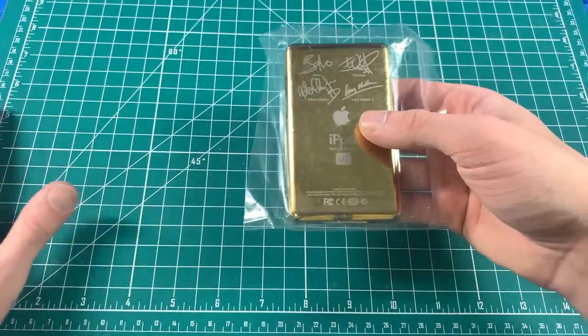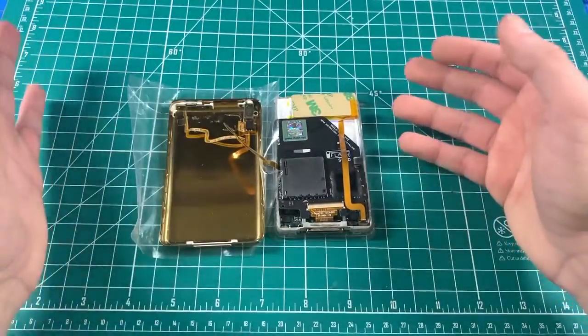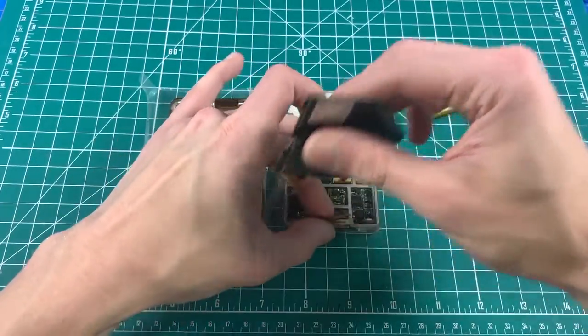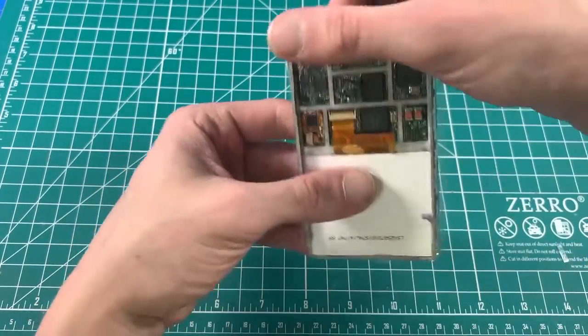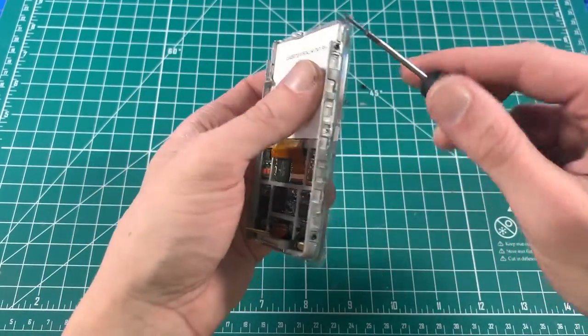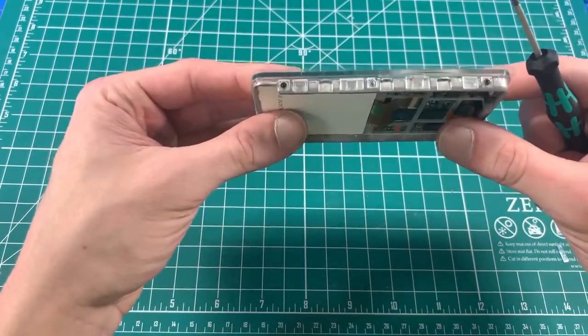This thing just tested perfectly. Now for the final steps of assembling this iPod. When you screw in the faceplate to the midframe during final assembly, you want to use the method where you screw in a distributed pattern — here, here, and here — to distribute pressure evenly.